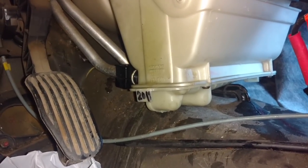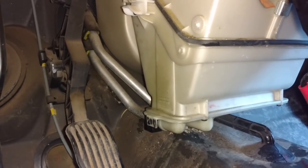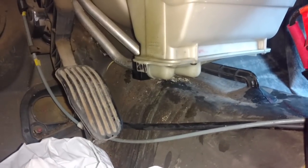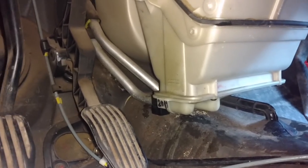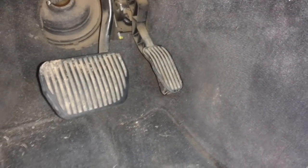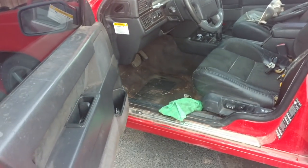Put the thing on — do not over-tighten that screw, and you'll be good to go. Screws in there, tight — I just tightened it with my hand until it got tight. One time I over-tightened it, thought I was dealing with a lug nut or something, and that thing pinched the seal and started leaking. So I had to get a new seal, take it loose, put it back on — haven't had a problem since. I wipe it down real dry, drive the car before I put everything back together to make sure it's not leaking, then I put everything back together. Wiped all the coolant from under the floor, under the carpet — I'm probably going to take this carpet out and pressure wash it. Heater core is fully secure. Now I'm going to put coolant in the bottle and take this thing for a test drive.